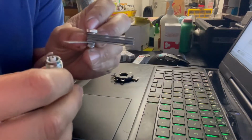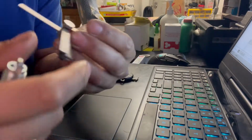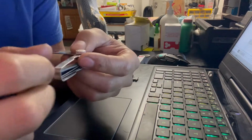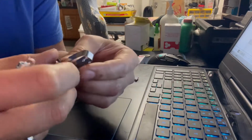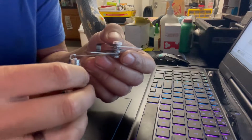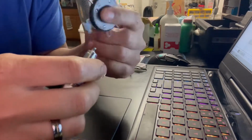So we take our feeler gauge, we try to stick it in here, and 25 is pretty small, so that actually fits pretty easily. So I'm going to try a bigger one here and see if I can measure where it's at in stock form right now. So that barely fits in there for the 30. So let's gap this down a little bit, down to 0.025.